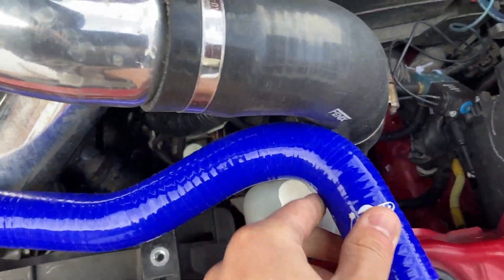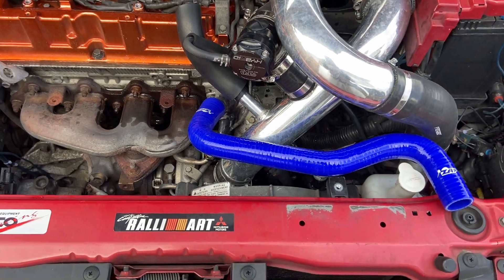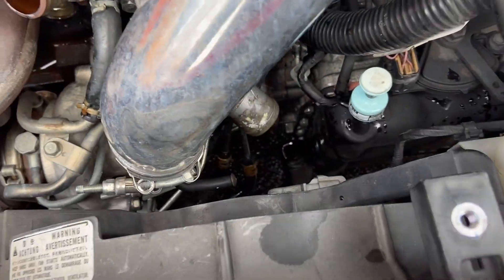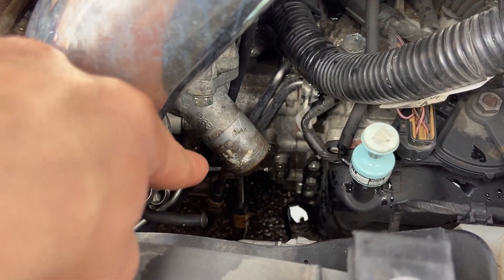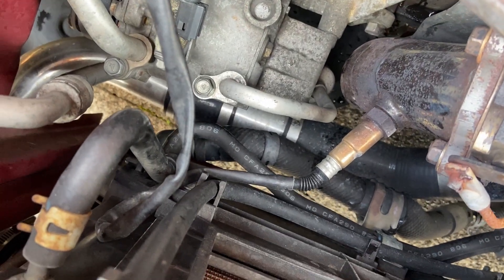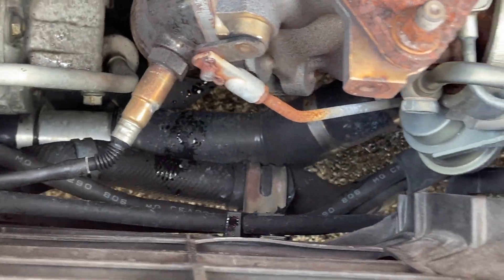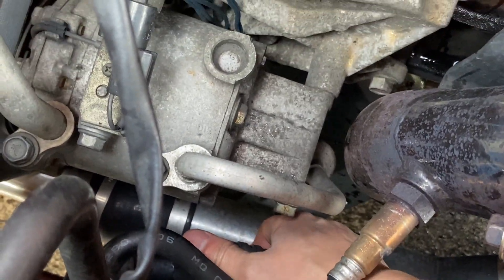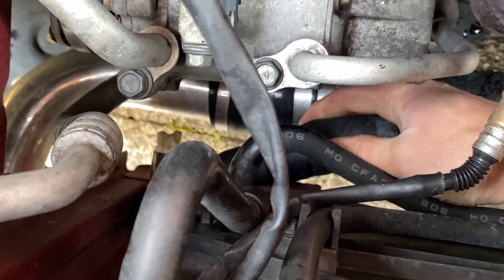It definitely goes on, just need to figure out the orientation. The under panel is now off — it was a pain. Got the lower radiator hose off from the thermostat side — that pipe is just hanging there. Got the hose clamp off this side and unbolted the bracket. Going to reach down and try to pull the hose off; the car has been sitting for a bit to cool down. It is good to do this when the car is cold.